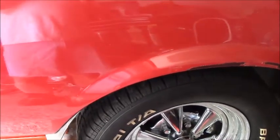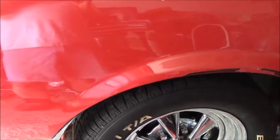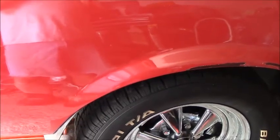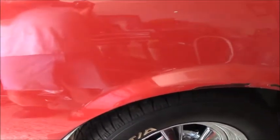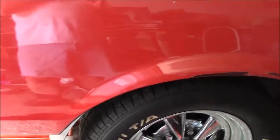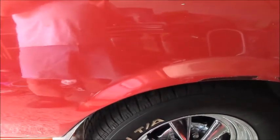So I'm going to take the wheels off and let it down very low so the wheel drums almost touch the ground, and just put the bleeders on there and let them trickle out. There shouldn't be much air in there at all. I just took the wheel cylinders off and I capped off the hoses, the lines, so air shouldn't have got in there.